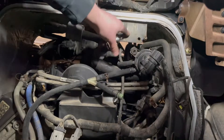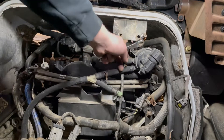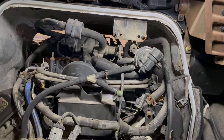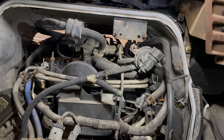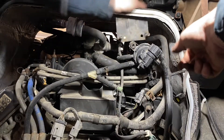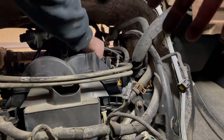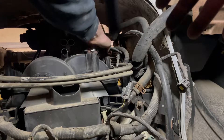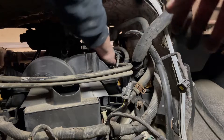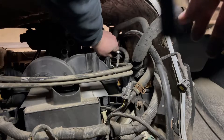Couldn't really use the lift for this one, so we're having fun up in here. We're inside the van now — we've got to take this bracket off. They made it a different size of course. We remove these two nuts, get this out, take the vacuum line off the throttle body, swing this whole thing off to the side, and just keep chipping away getting all this stuff out of the way so we can get at this manifold. You know how the design conversation went: more brackets, different bolt sizes, all in hard-to-reach places.